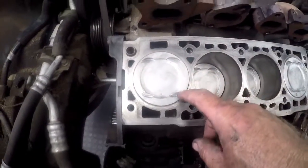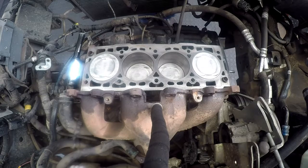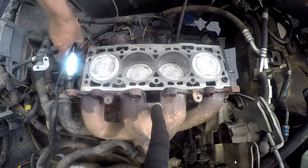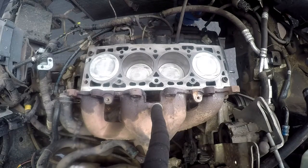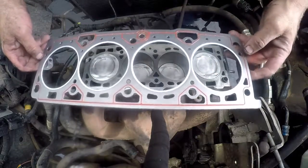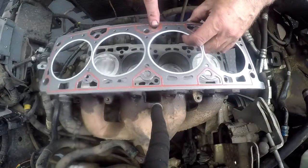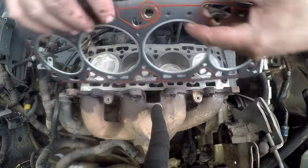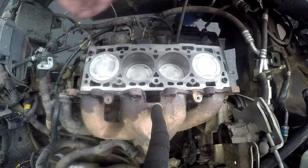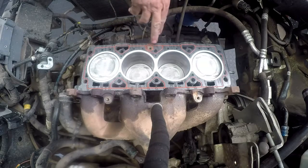If you look at the piston itself, you can see that the piston is pretty much up, which confirms top dead center. I also always make sure that the dowels are in place. So when we take our brand new gasket, I normally look for the oil jacket on the cylinder head and the oil jacket on the gasket, which normally has a little bit of brass reinforcement around it, as you can see. That will basically line up — so we have to turn it around to put the gasket on the right way.